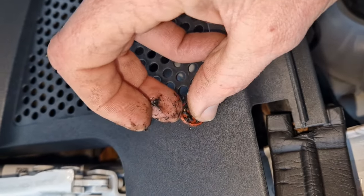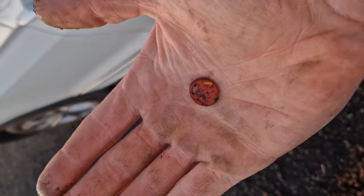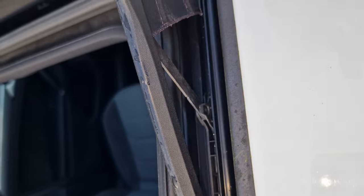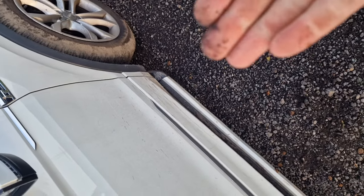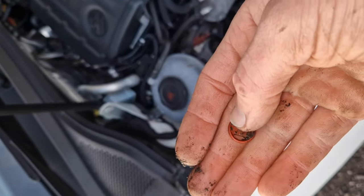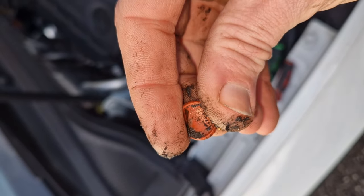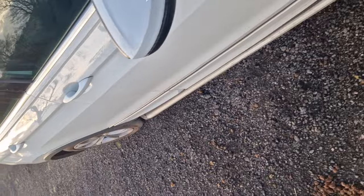But because they get all the grime and crap stuck in them, they clog up and stop your water draining. The water carries on and instead of going down the drains, it goes over the channel and into your car. So if you've got wet carpets, water present, and your windows are steaming up, it's worthwhile just having two minutes checking under there to see if you've still got these red rubber flaps on. I'd recommend just removing them — they're only there to stop insects getting up into your car, but what do you want: a little spider running around or a car that's soaking wet? If you like the video give it a like, and there'll be plenty more to come. Cheers.